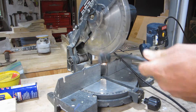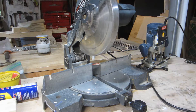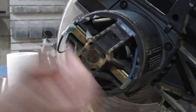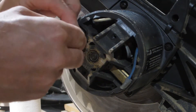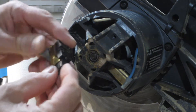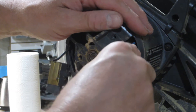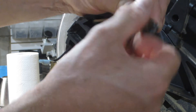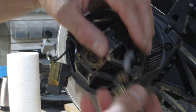That's not just because it's not plugged in — seriously, it doesn't work. How bad could it be? That is the question of the day and we'll just pull her apart and see what we can find. Just off the bat, the brushes are in good shape. They're making good contact with the commutator bar. I'll just pull these out a bit. There's plenty of meat left on these things, so that's probably not our problem. There's a bit of wear on them but nothing too bad, and there's lots left to go around.